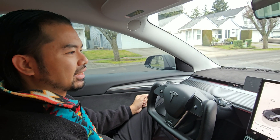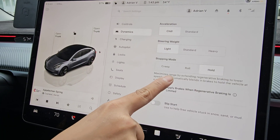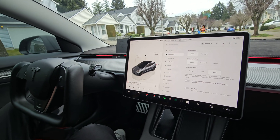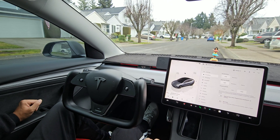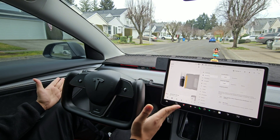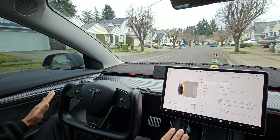We're on to the last part, which is Tesla's hold mode. We're in park and we're going to go ahead and click on hold. It tells you what it does: it maximizes the range by extending regenerative braking to lower speeds and automatically blends in brake to hold the vehicle at a complete stop. So let's go ahead and switch to drive. I want to emphasize that this hold mode is what I use 100% of the time when driving this car, because I want maximum efficiency of my driving range. We're not moving right now — if I were to let off on the brake pedal, I'm not going anywhere even though I am on drive. The car is holding my position, so I'm fully stopped.